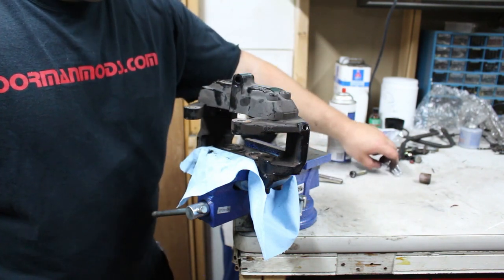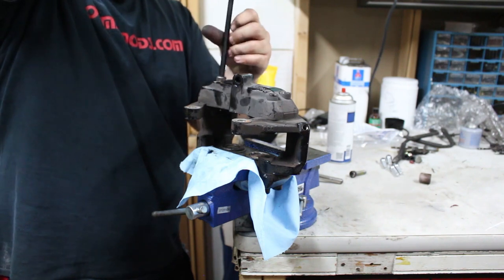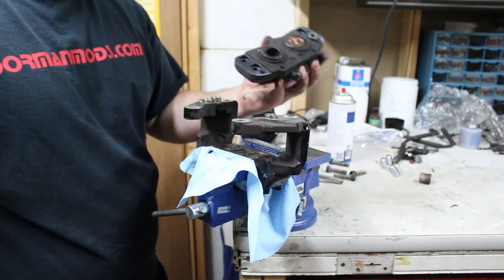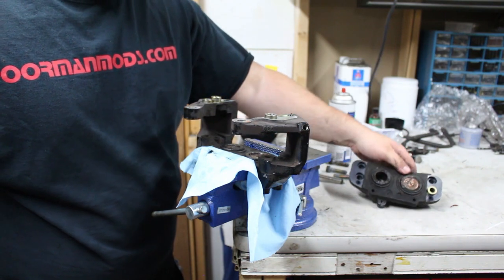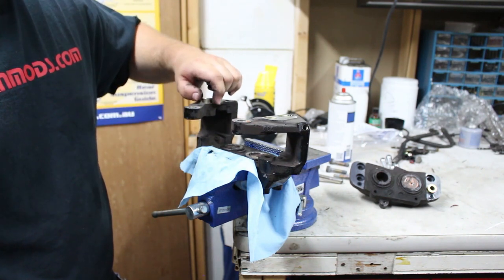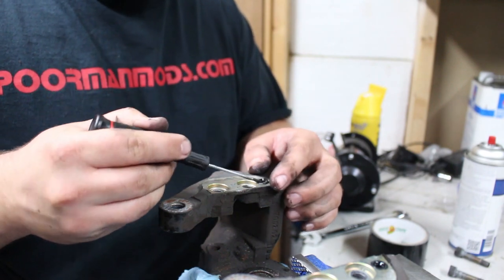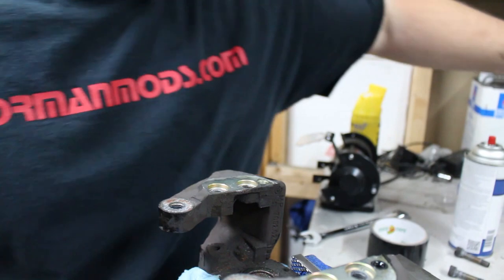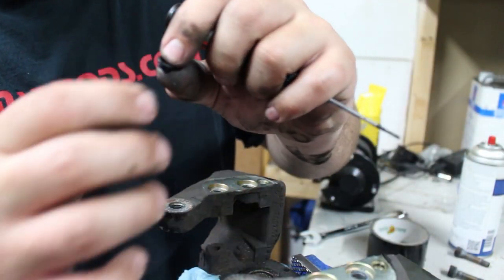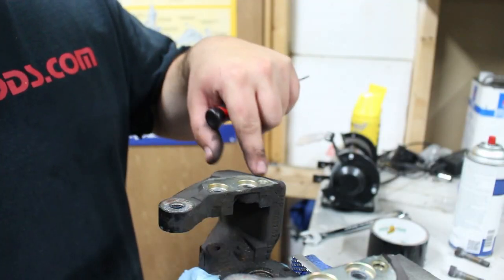On the bolts that are facing the front, I'll be replacing them with these nice chrome bolts to make it look nice and purdy. This part comes right off — there is part of your caliper. Now save these. There are also very tiny O-rings right here and right here that you need to remove and save. Only remove them if you're powder-coating. I don't know if you can get replacements for these, so if you lose them I don't know what you're gonna do — they're not regular O-rings. Keep these. Now we'll flip it over and do the same exact thing.